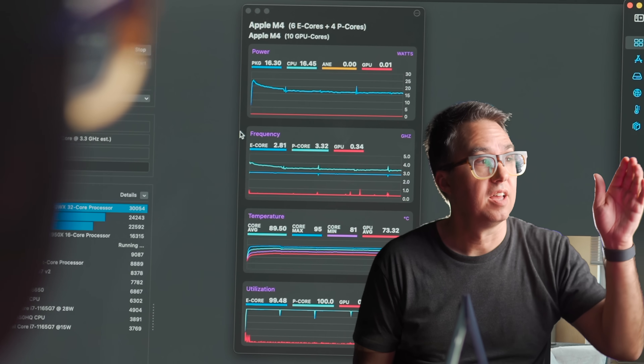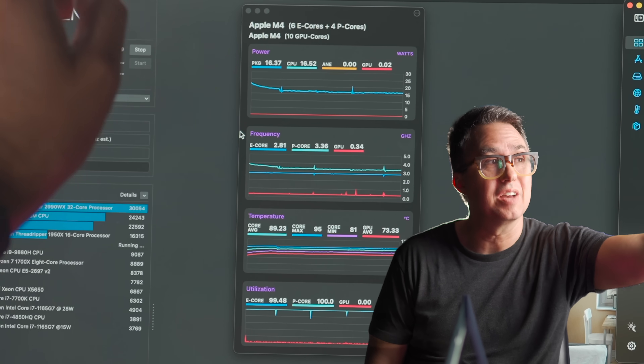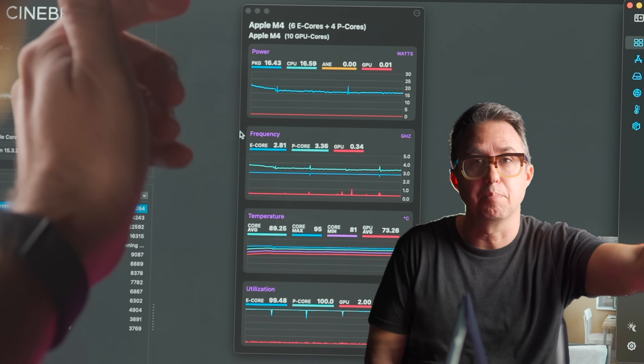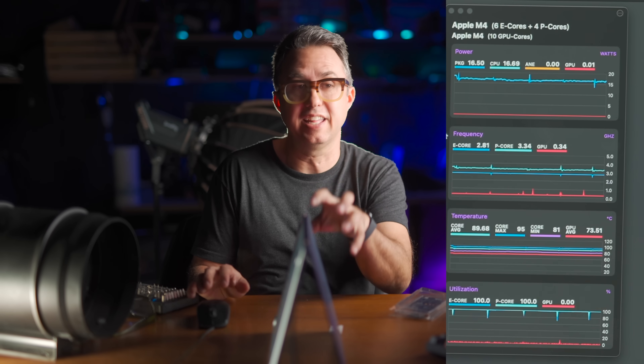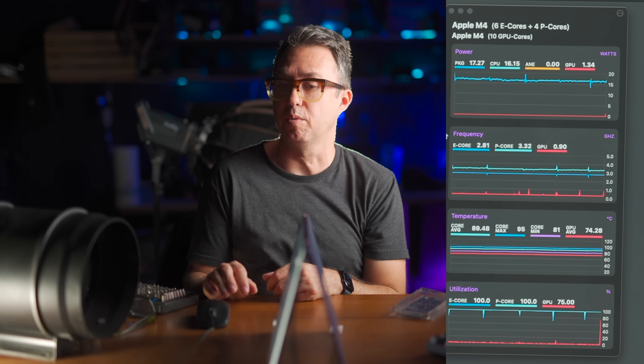We are officially more than halfway through the test. I have almost a straight line in all these graphs — it is stable, it is going to stay at these numbers. Where we had 6 watts before, we have 16 — more than double the amount of power is allowed to go through here because of the cooling. Where we had 1.9 gigahertz or less on the p-core, we have 3.36 — not quite double, but it's a big improvement. Those of you running virtual machines, or doing scientific data processing, or exporting lots of photos in Lightroom — those tasks churn and heat things up. I guess the few times in a month that you have to export a thousand photos at once, you set your computer up like this.